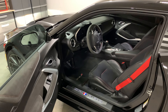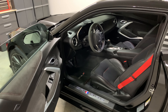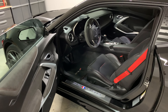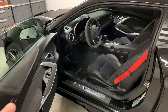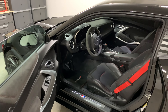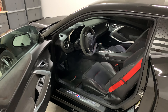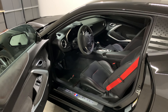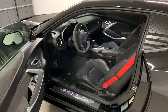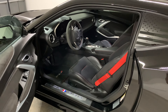That's pretty simple really — you just have to know the secrets of Chevrolet. Almost every other vehicle you just press the button once and it memory recalls the seating position. With Chevrolet you have to press and hold to recall, and when setting you have to press SET then the number within about two seconds — and you have to hear those two beeps for it to be confirmed as set. There you have it — that's how to set the memory seat and easy exit functions, and how to turn them on in your dashboard, so you can get in and out of your Camaro or any other Chevrolet without messing your seats up. Thanks for watching — stay tuned, remember to like, subscribe, and share!